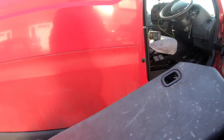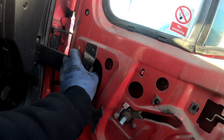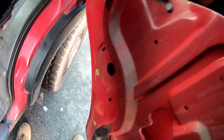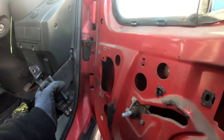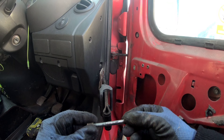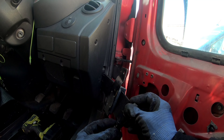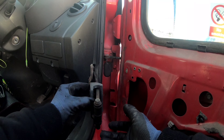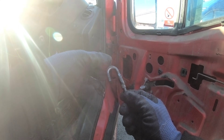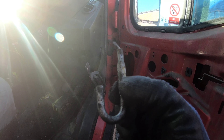Off comes the door card. I get this strap out of the way so I can look up at the mechanism from underneath. Seems to be a bit stuck - time for a hand hammer. There's something rolling around in my door, and it was the bolt off the bottom of this pin, as they probably call it. It sits in the top here and hopefully stops the door from going too far out. With the little pin on the bottom - the one that fell off - as you see, it stops the door. As I looked up I found this mechanism was broken. This is what latches onto the check strap. It has the nylon nut bit in the bottom, but it snapped.